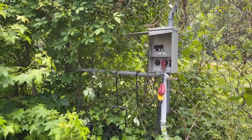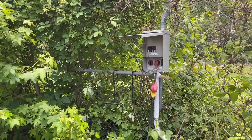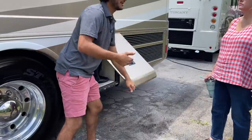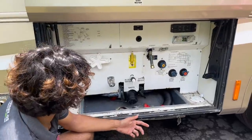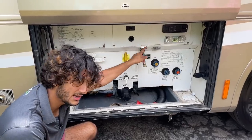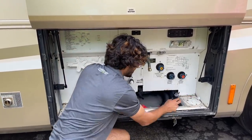That adapter allows you to connect, but it's still 30-amp — not 50. So in those situations when you only have 30-amp, you can't run two air conditioners, only one. If you trip the breaker it's not the end of the world. If you have a water source at the site, you'll be connecting right here — it says 'city water nozzle.' If you plug your city pressure in there you can pipe fresh water through your whole plumbing system.